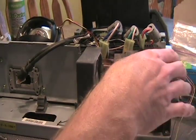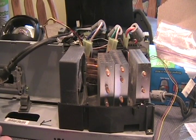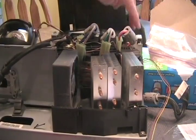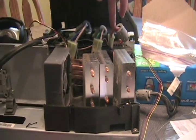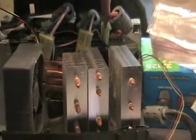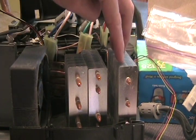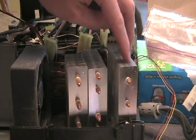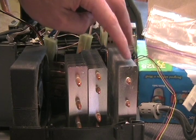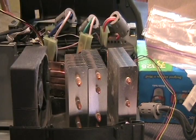Vacuuming those out — these remove the heat from your LEDs, which are back in here. For those who have the red LED problem, there's a video online that describes how to take this apart and take these out. You'll see the red wire for the red LED, the green wire for the green LED, and the blue wire for the blue LED. Most likely the red is the one that's gone bad. What happens is air flows through this chamber and it cakes up on the last and biggest heat sink. That one produces the most heat because of the number of fins and the size of the heat sink. It ends up at the back collecting all the dust, and that's the one that goes out.